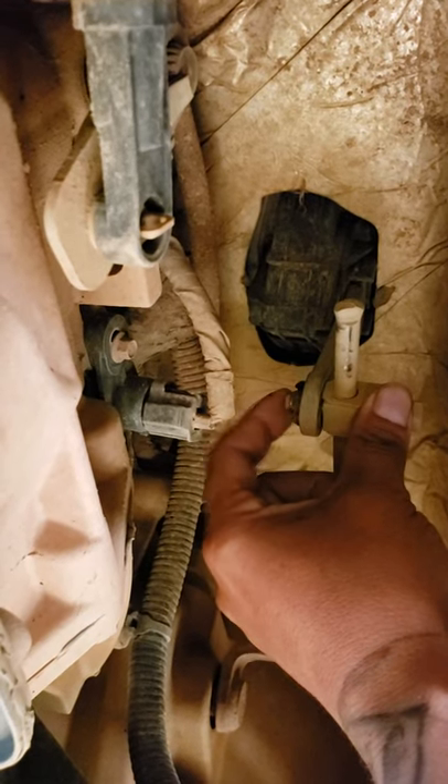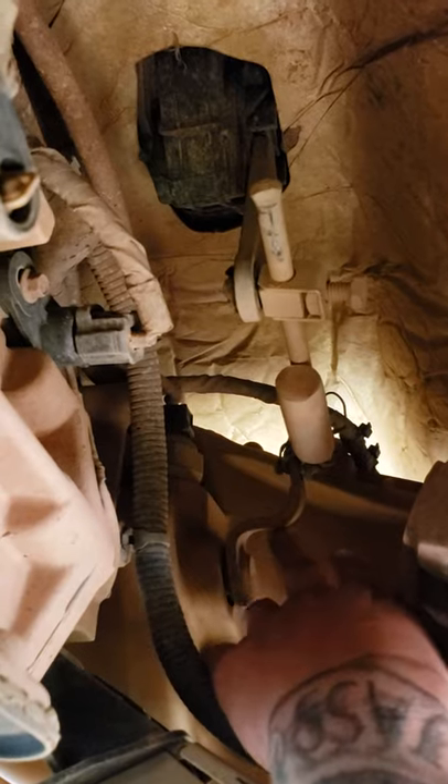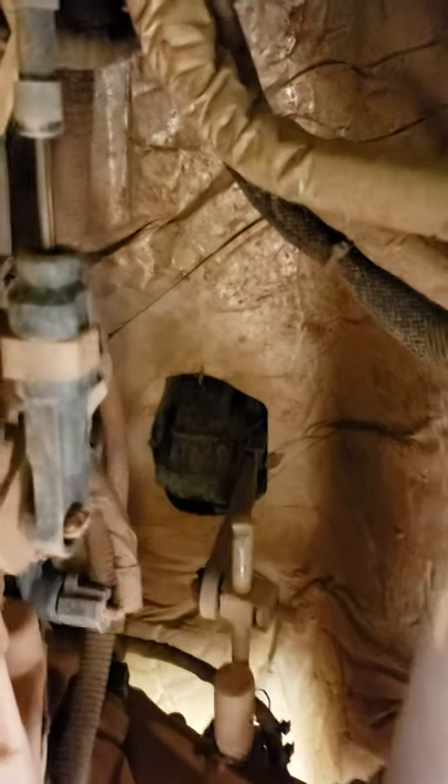It probably comes with some kind of clip, but I'm just gonna use some bail wire or a clothes hanger, wrap it up around this little nipple part, and try to secure it that way. That's all it is right there. Looks like somebody already repaired the other side. That's the part that engages your 4x4 - it's the extra shaft that goes in and turns your wheels.